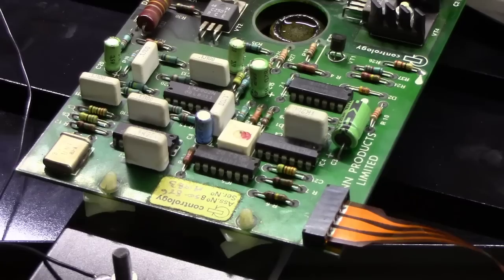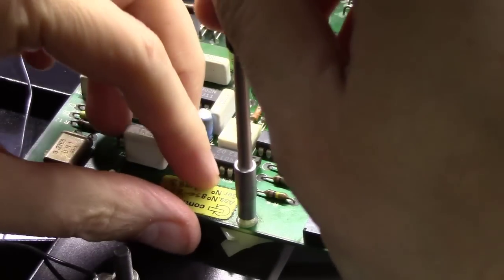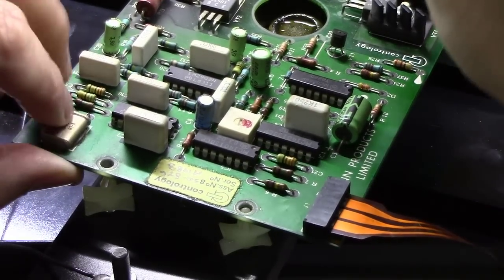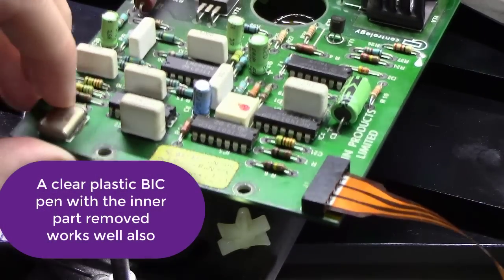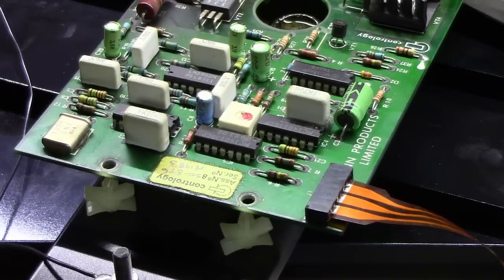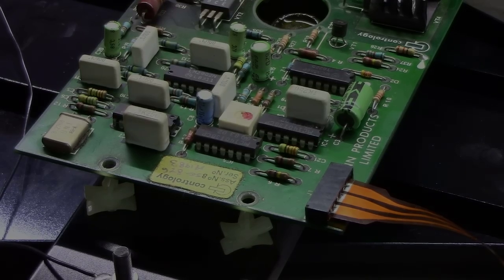We'll come over here, and all you do is use this little socket to push down on top of these things, and it pops them loose because it squeezes both sides of them together at the same time and lets these things come off. So you work your way one at a time, pushing them like that, and you'll eventually get to the other side here and get it off. I'll show you. There we go.